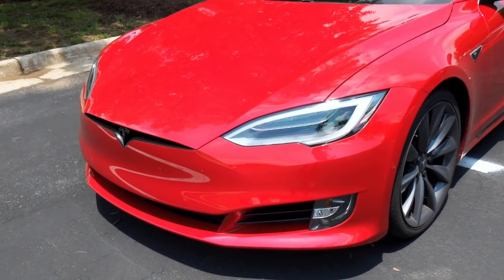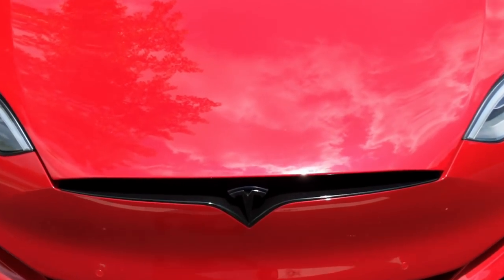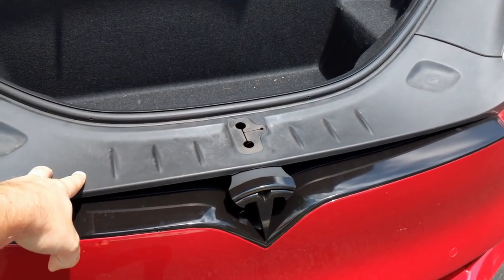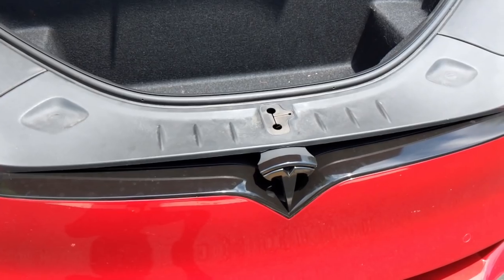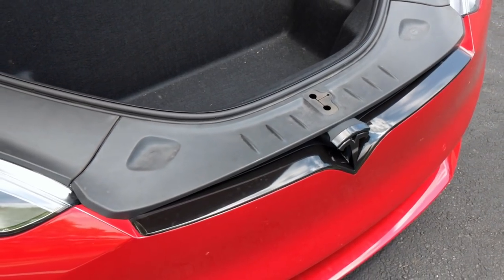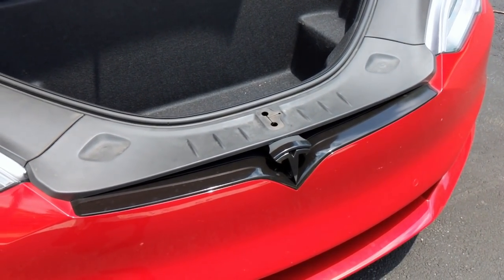I'll start up front with these first two parts and the little piece underneath. Let me pop the hood. It's definitely best to take off the T emblem in order to do this bottom section. To take off the T, remove this plastic cover right here — there are two Torx bolts on top. I can't remember if they're Torx 20 or 16, I'll put it in the description. There's also one on the back side which is tricky to get to. I'd take the bit and use pliers to turn it because the clearance is really small. But you can get it off and the entire piece comes off.